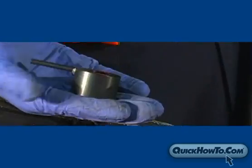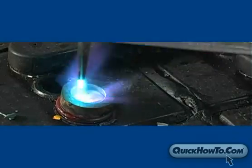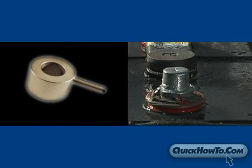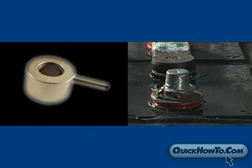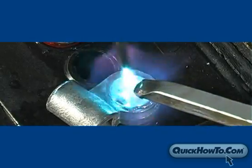Choose an appropriate post mold. In this video we will demonstrate rebuilding a post with a standard post mold and Quick Cable's lead head post mold. This particular post mold will create a post tall enough to burn down and fill the lead head cavity, creating a tight seal.